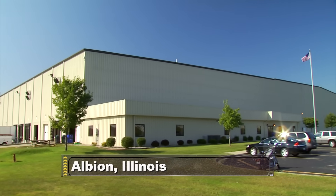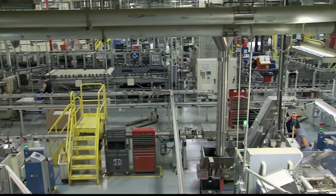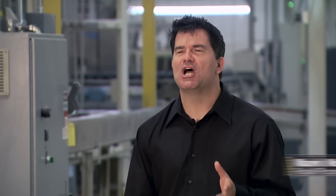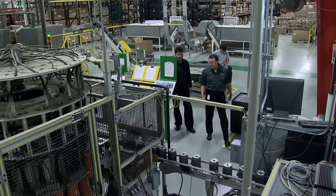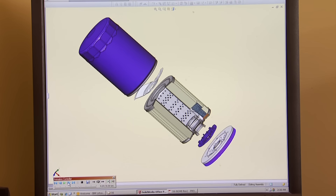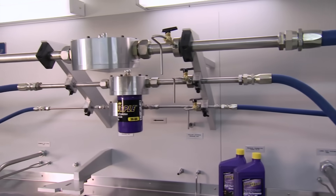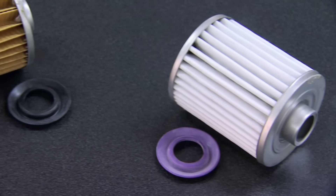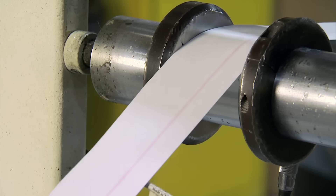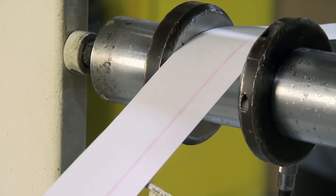For that, we travel to a 355,000 square foot facility in southeast Illinois. When someone makes a decision to upgrade to a super premium lubricant, one of the first questions we get asked is, what filter should I use? That question prompted the research to bring to market a truly synthetic ultra-premium filter. To develop it, the element inside has to provide almost perfect particle removal while also allowing maximum flow. Most filters compromise with a synthetic cellulose blend — the Royal Purple filter is 100% synthetic, primarily fiberglass with some polyester for structural support.